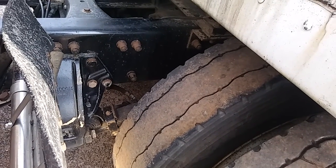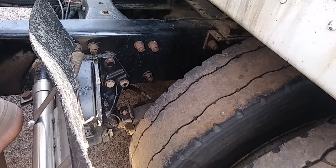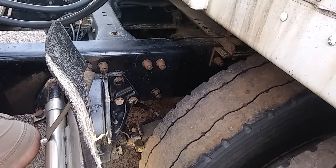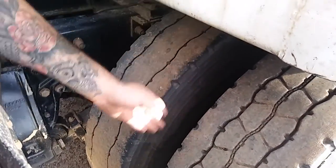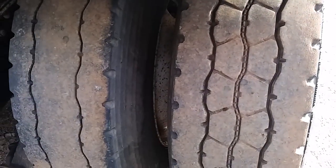Checking my inner rim. My inner rim should have no illegal welds, not cracked, bent, or broken. I will check both inner wall and outer wall of both of my tires. Make sure there's no abrasion, bumps or cuts, and they're properly beaded around both of my tires. Checking my inner bud rims. My inner bud rims should have no daylight or debris present.